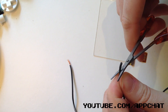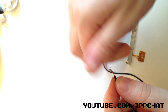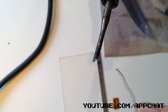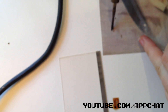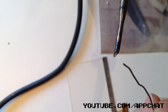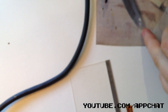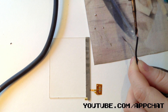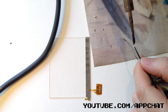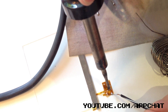Now we need some wire and the 47 OHM resistor. I'm preparing the wire by cutting off its insulation — it's just copper wire — and then I twist the end to make sure all the pieces of copper are together so the current will flow smoothly. If you're new to soldering, definitely look up beginner soldering tutorials on YouTube. Also you want to clean the soldering iron by putting some solder on it. Here in Australia we call it 'solder' — in America I think you call it 'solder'. Once you do that, you run it up and down the wire to coat it nicely to ensure a good connection.